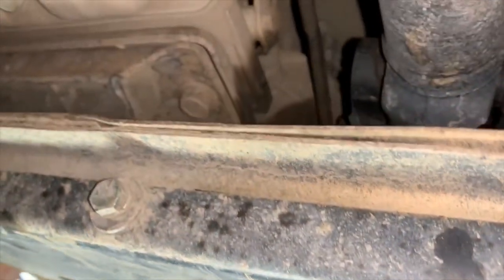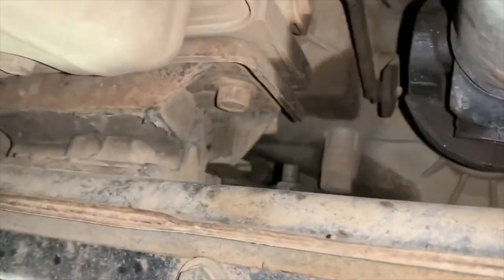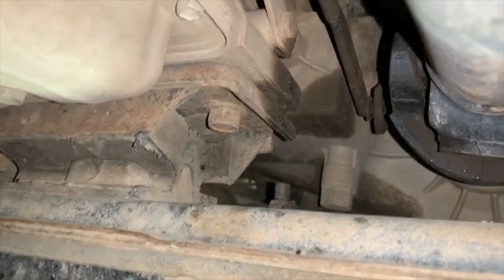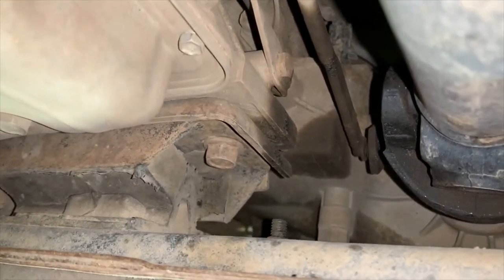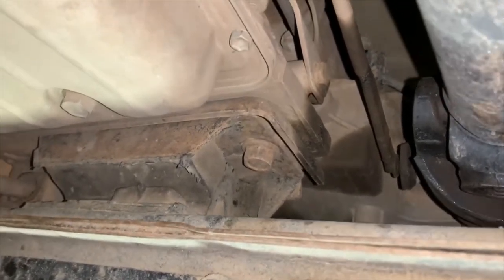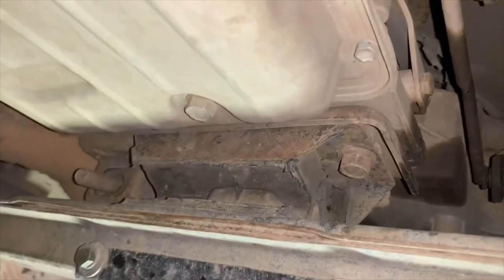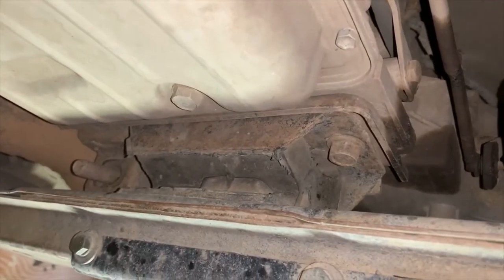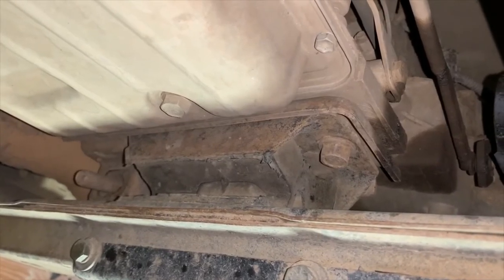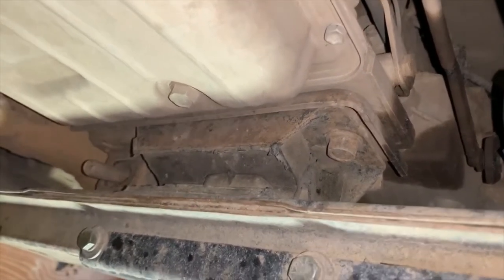If you use a ratcheting combination wrench, like a box end open end, you will not hit yourself nearly as much as if you do not, because the clearances are tight in there. It is what it is. But Brown Dog seems to really stress that you should remove these or you will tear up your rubber mount and cause all sorts of nasty vibrations, which you will then blame on the mounts. So they probably know what they're talking about. Let's do it.